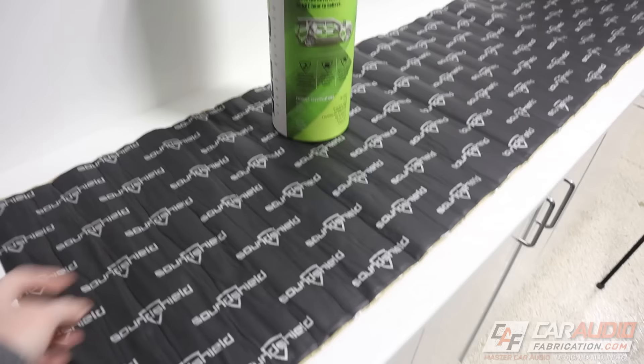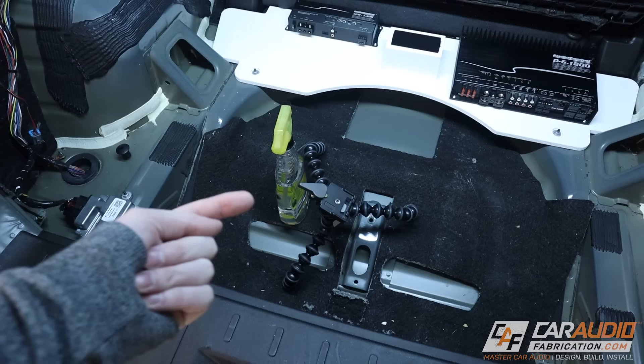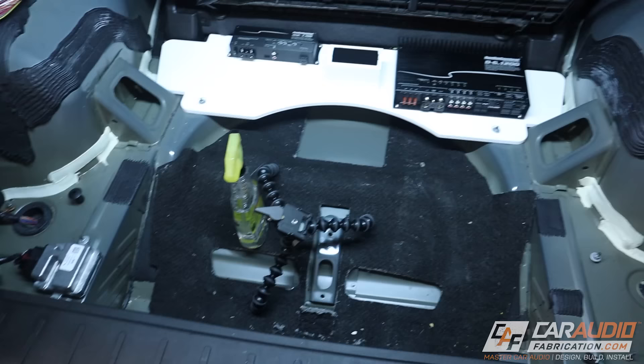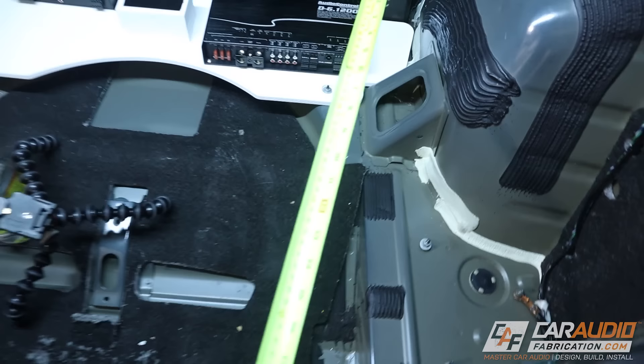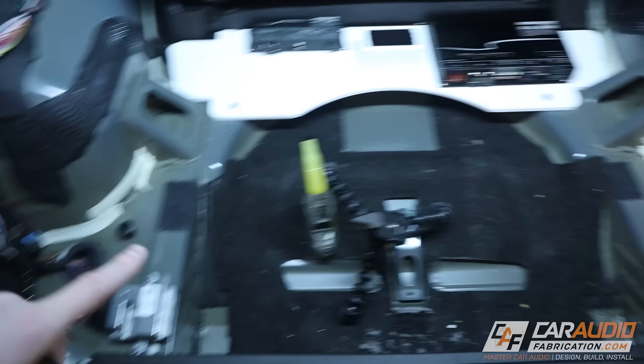I've got this piece from that roll. To give you an idea, here's a 15-inch sub — you can see on top of this piece of material, it is a big chunk. Something you guys always ask on sound deadening videos is how do you know how much material you need? It's really not that difficult. Let's say I want to determine how much I need for just this back area. With a tape measure, it's about two feet deep and about four and a half feet wide — we'll call it five just to have a little extra. So two foot by five foot is 10 square feet, meaning I should be able to do this rear bottom area with one roll.